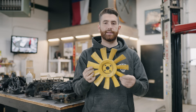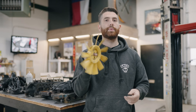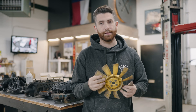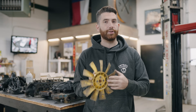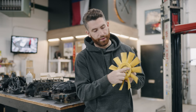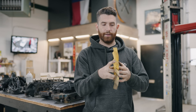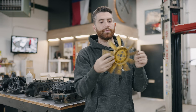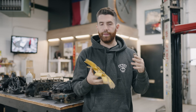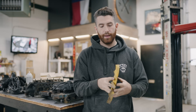In order to get air to pass over the radiator, we need a fan. This is a Classic Mini fan that came on most of the cars, and it has a design flaw — it can be installed backwards. A lot of cars come through the shop with the fan installed backwards. Although it still works, it's way less efficient. The correct way is with the smooth side facing the engine: engine, then fan, then radiator, with air passing over the smooth side. With it installed correctly, this fan moves a lot of air — if you put your hand by the fender while the car is running, you'll feel it. Because it's driven off the engine, you essentially have a 50–60 horsepower fan.